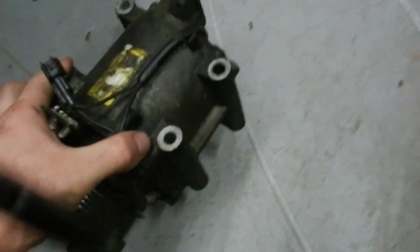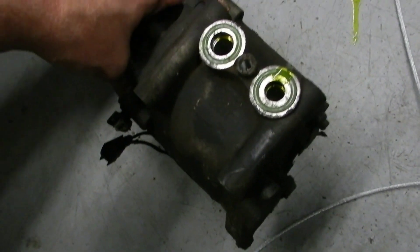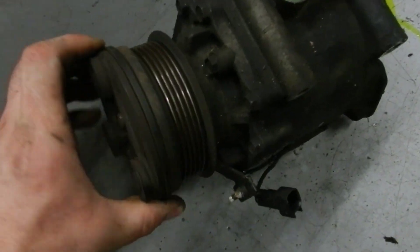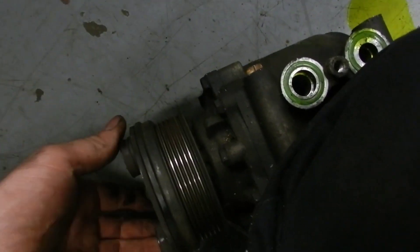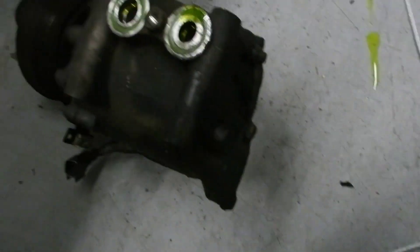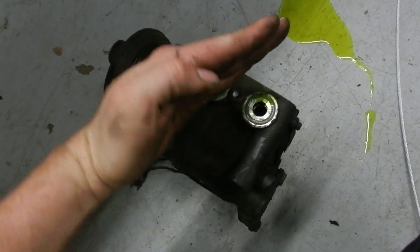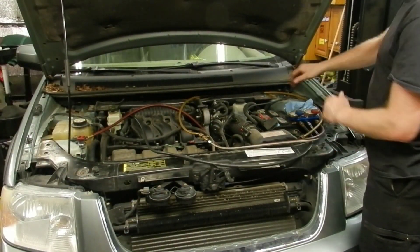Here's the old compressor — it's right here, just an ugly bastard, hideous, covered in who knows what. There goes a bunch of oil — now I've got a mess to clean up. Here's the old unit — it doesn't feel very good, it's like too smooth. I've never had one that smooth — no wonder, all the seals must be out. It's like there's one piston that might be compressing. These things have several pistons — they've got a wobble plate that sits like this and does this oscillating thing, and then there's a bunch of pistons inside that compress the gas.